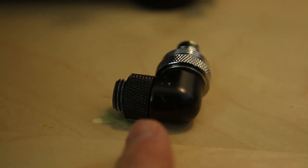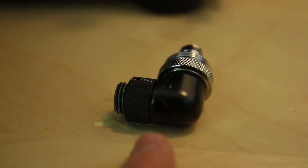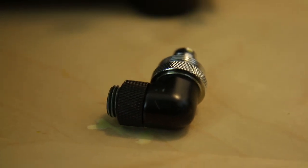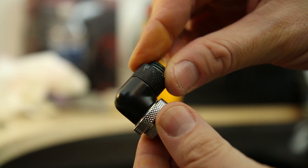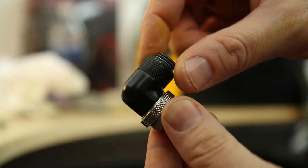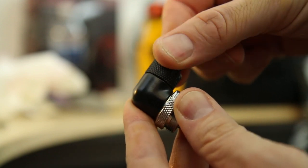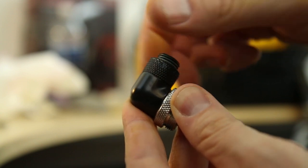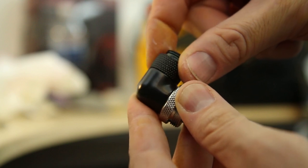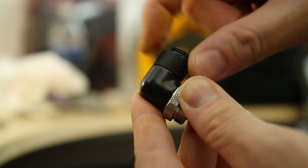The leak actually happened right there in the rotary part. And how does that happen? The part doesn't really move or anything. It just eventually — fluid worked its way into the O-ring, and once a leak forms, it just gets bigger and bigger and bigger. Here's the rotary fitting — it turns right there so you can rotate the fitting, that's why it's called a rotary. These parts are held together by nothing more than the pressure fit of an O-ring and a groove. It feels fine right now, but if you look, there's quite a bit of play in that. That play was there when I installed it, but it's not abnormal — just about every fitting I've ever used has had play in it. Bits Power seems to have the least amount of play, but also the least rotation because it's extremely stiff. But even Bits Power have been prone to leak in those joints.